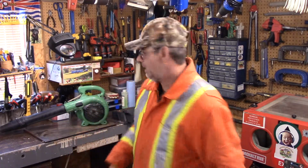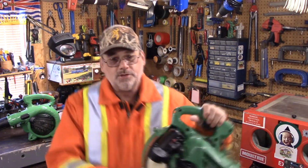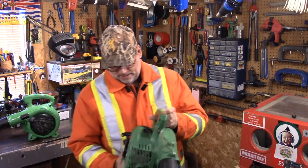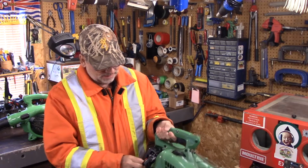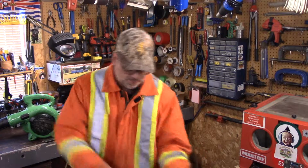Okay, now I'll take you over to the other one here. And this is what all of a sudden I started to have happen. Now you can see here, yeah, that's a brand new primer bulb. And I'll put the choke down. I'll give it some primes. As soon as I take the choke off, it'll die. Now I could pull on this forever and it'll do the same thing. It's like it's starving for fuel.